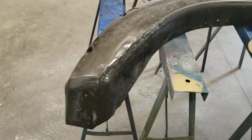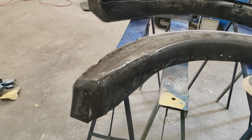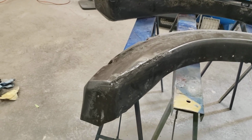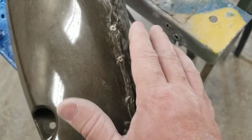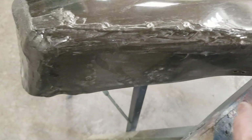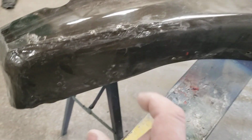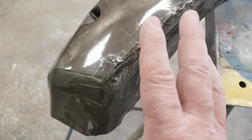So this stuff, when you bond metal together and basically make it super rough, like 36-40 grit, stick them together, and then go to pull them apart, the amount of power it takes to pull it apart, you'd be ripping steel and wrecking stuff. So it's good. So what I did after this was initially epoxied, riveted, I used the panel bond adhesive as a filler. I put a lot of it on, and anywhere where there was a gap, I grabbed a Bondo spreader, which I cut down to about 1 inch, just so that you could shove it in real well. I mean, this stuff really holds. Like, this will never let go.